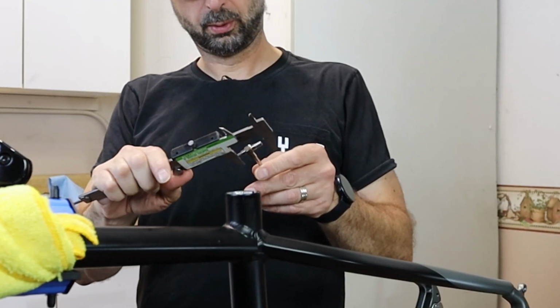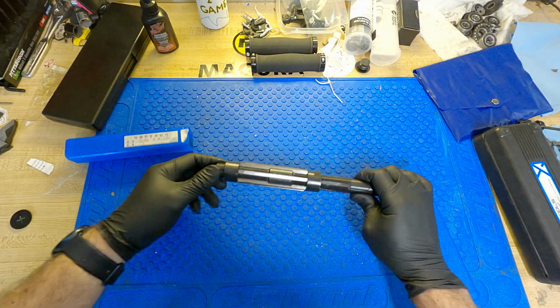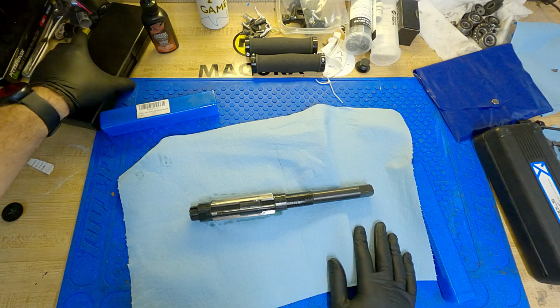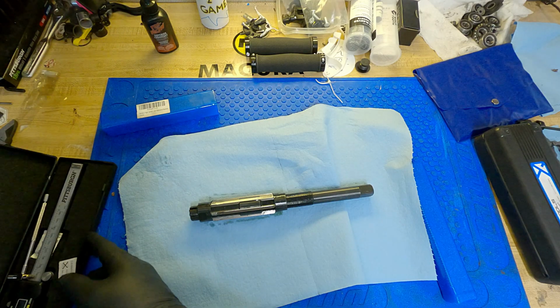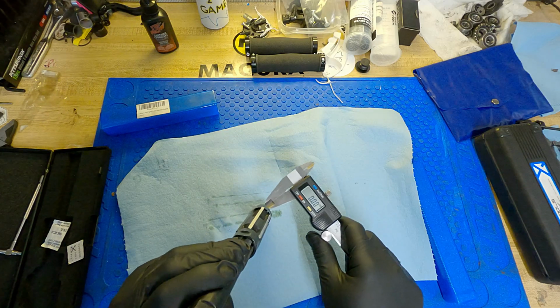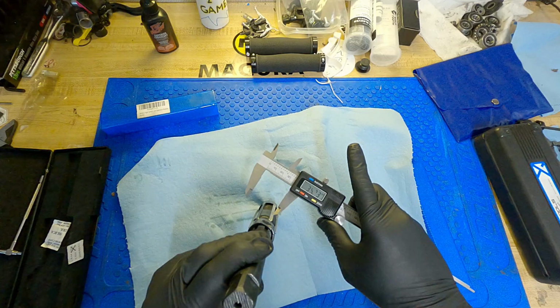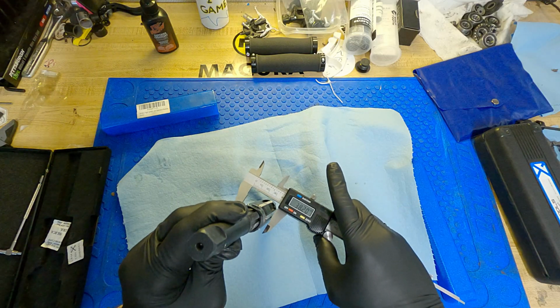Next is the Reamer. This is a cheap adjustable reamer I bought on Amazon. Links to all the parts and tools will be in the description. Next step, we're going to measure where we're at. You have to measure the blade edge to edge, so it can't be flat to flat, it has to be edge to edge. You have to be really careful here in how you measure.